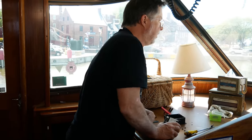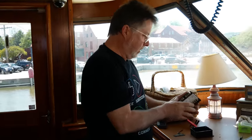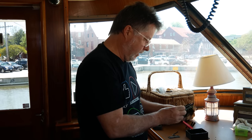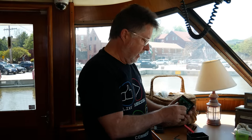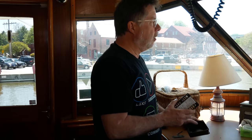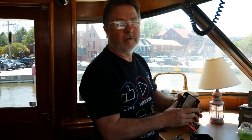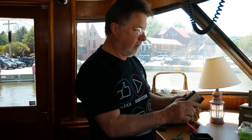Cable master, or Glendinning cable master, that lets our electrical power cords in and out. One of them stopped working, and we had hoped it was just the toggle switch. Lynn went in and installed a new one, and that didn't do it. And we realized it's actually the relay board. And I know that because since there's two power cables, I swapped out the relay boards to see if that would solve the problem, and it did.